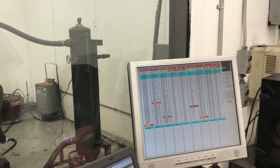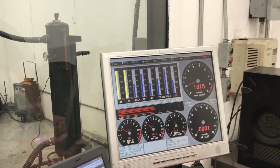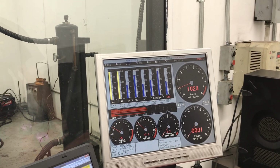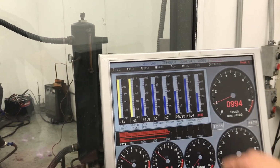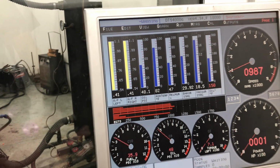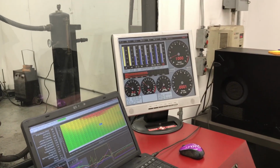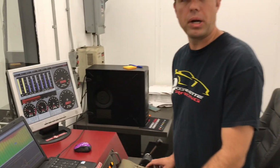Another thing is it's making, what, 18 inches of vacuum at idle? Oh yeah. One thing we forgot to point out here, and that was pretty much just a warm-up run, but you can see our idle vacuum is right at 18.5, 18.7 inches of vacuum there, and that is suitable for pretty much all emissions applications. I mean, this thing is gonna idle like stock.